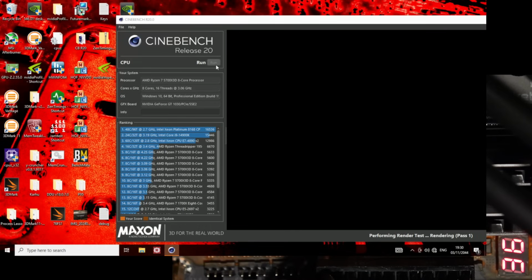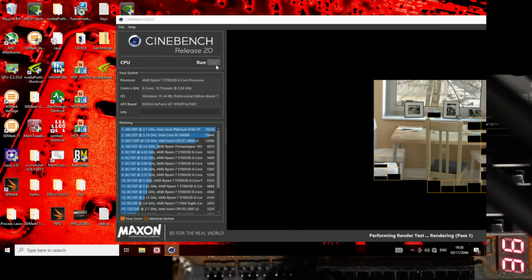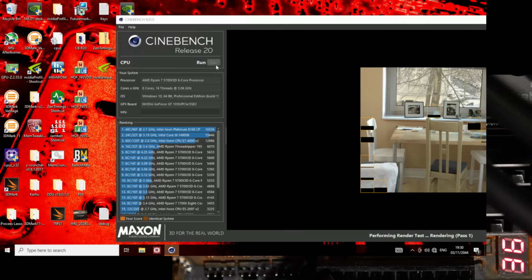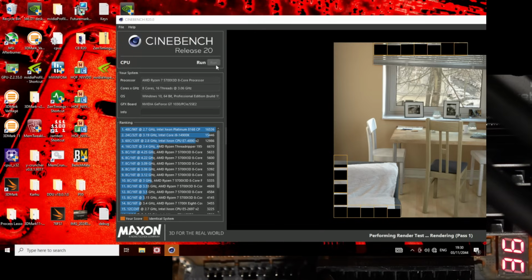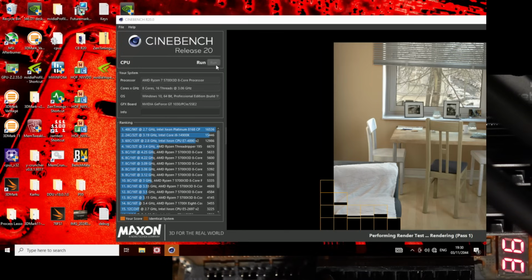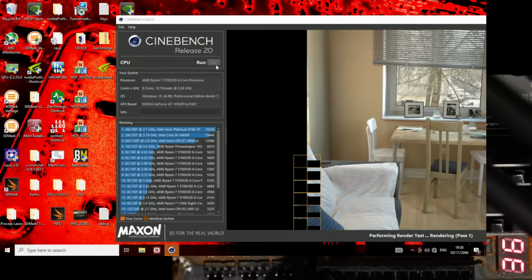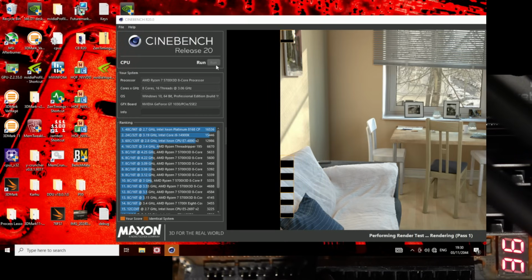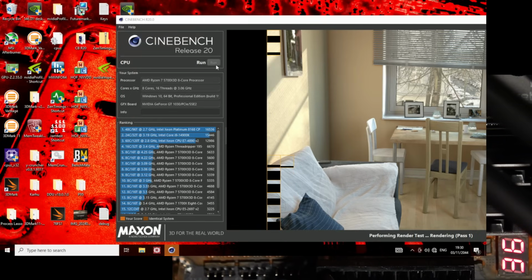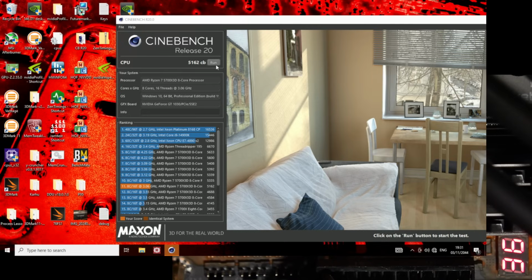Now, especially with undervolting on Ryzen CPUs, I recommend that you don't monitor the clocks and you just look at performance and benchmarks, because in my experience with Ryzen CPUs, undervolting will very often cause clock stretching. A lot of the time that isn't particularly visible in the frequency readouts because the boost algorithm runs on a 1 kilohertz refresh rate, which basically means it can change the core clock 1,000 times per second, which you're not necessarily going to see in monitoring software very closely. And actually, the clock stretching happens at an even finer time scale than the main dynamic frequency behavior. So if you're messing with undervolting on any Ryzen CPU, in my opinion, the only thing you should do is look at the performance.